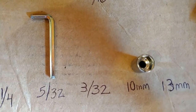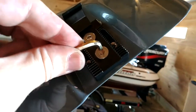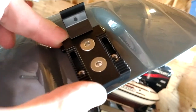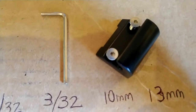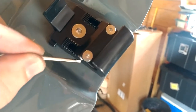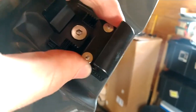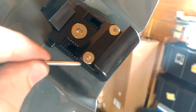For this part you're going to need your five thirty-seconds Allen wrench and your 10 millimeter hex nut driver. Go ahead and make sure that this is good and tight. Make sure that this is pretty much in line in the center and that it's not twisted to one side or the other — it does have a little bit of wiggle room before you tighten it down. For the last part you're going to need the three thirty-seconds Allen wrench to install these bolts down into those small nuts. It might take a little bit of playing with to get it to line up. You don't want to tighten it all the way right now because you're going to want to be able to slide this up and down in order to make the hood as tight as you need it to be — just make sure that it threads first.